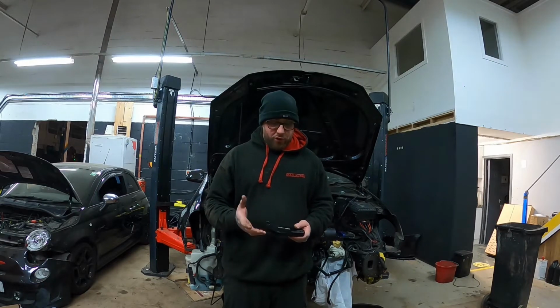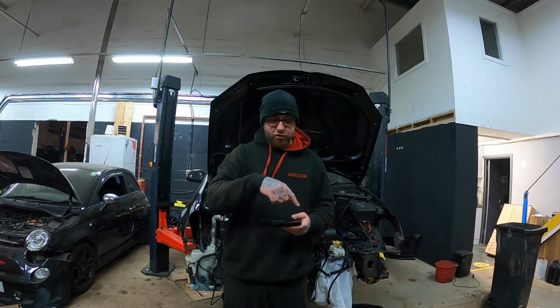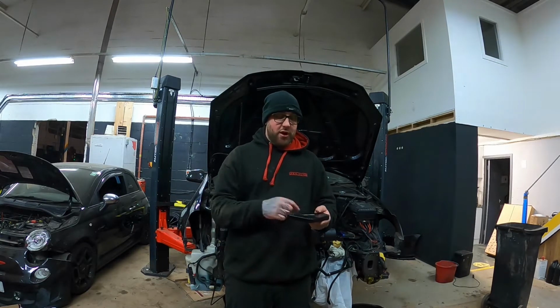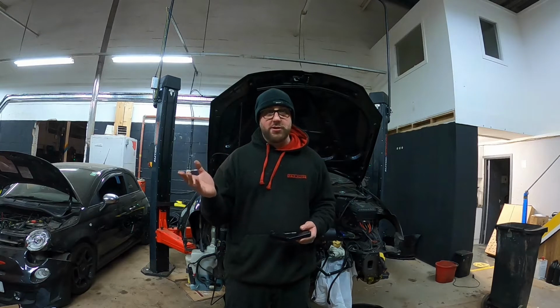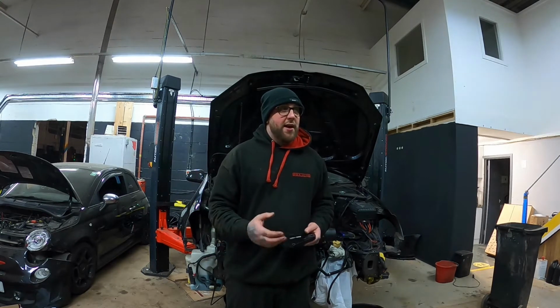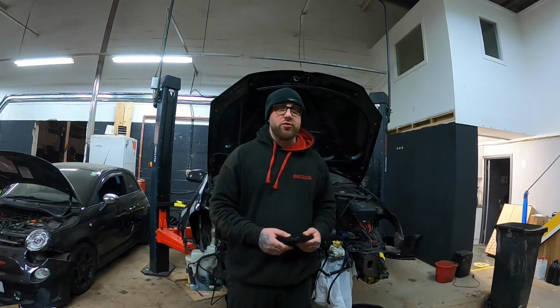Well, that's what the OEM one's like, same as this, and then obviously it has two coolant pipes off, so the coolant runs straight through the heat exchanger, and the oil comes from underneath, runs inside. But what that does is, not only does it help with the cooling when it's up to temperature, it helps get it up to temperature, because DSG fluid, unless you're driving it quite hard, it takes a while to warm up, because there's no heat.